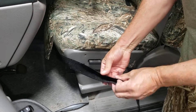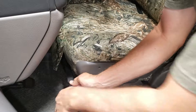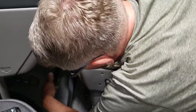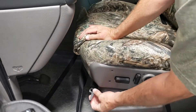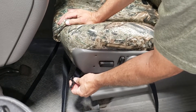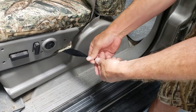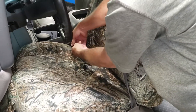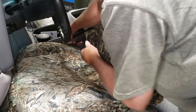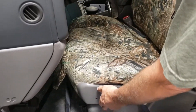To route the velcros, fold them in half lengthwise with the sticky part in — this stiffens them up just like a ruler and makes them easy to poke underneath the seat. Fold the outside and inside velcros in half. Note that there are also buckles underneath the front right and left corners — make sure those aren't tucked inside your cover.